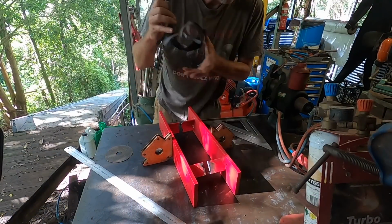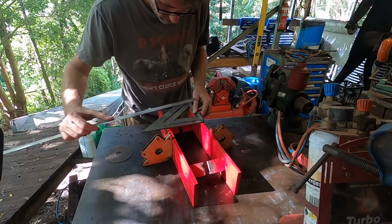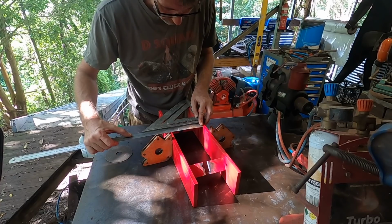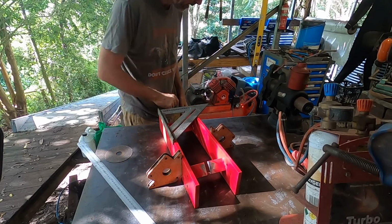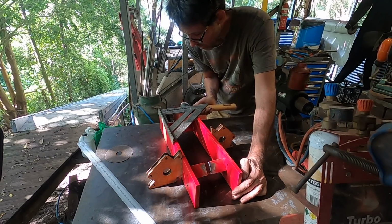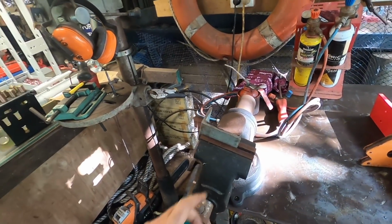Alright, got it here on the welding bench. So I think I figured out about 125 internal will do. Alright, let's see how we are end to end. It's got to go that way a little bit. Let's grind this gal coating off around the weld now so we don't breathe in too much vitamin G.